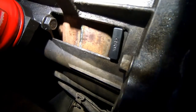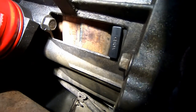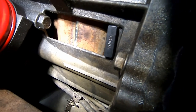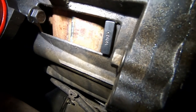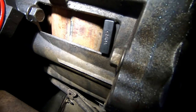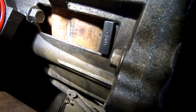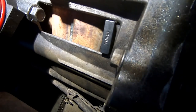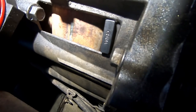The flywheel lockout plate is in place — my truck never came with the shield that goes in there in the seven years I've owned it. You'll see the little lockout plate right there, fed in front of the torque converter, locked into the flex plate. That's basically going to lock the transmission in place so it won't move anywhere.